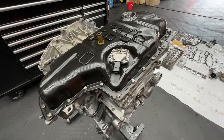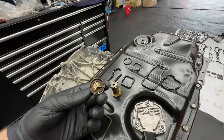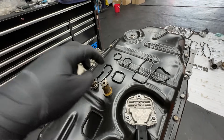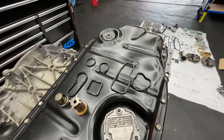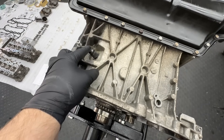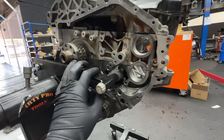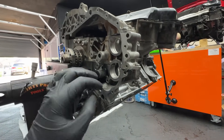So we have a day after - we put the sump on. We also replaced the thermostat which was placed in the oil pump, the one-way valve which helps the oil to stop when you shut the car off, and all the gaskets. You can tell the gaskets are freaking old and just cracking - not rubber anymore. We also put the pin for the crankshaft so it's in timing position. Now the plan is we will turn the engine, put it on the table, continue from the back to assemble the timing chains, and once all the gear setups are in, continue with the cylinder heads.